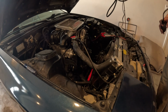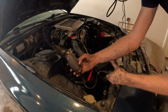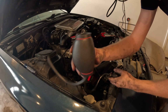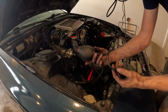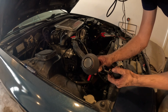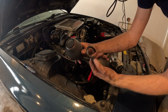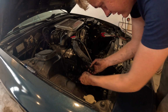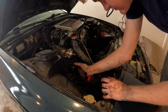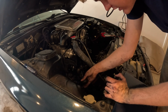So like you probably saw, they did not tighten that intake down, which can't be helping me. But anyway, I'm gonna start using this attachment here. Now, I ordered this, but you can get certain kits from Autoline that come with it. See how when I pump that up with this whole hand thing, it fills stuff? Pretty cool. So this will fill like an exhaust tip, in my case, an intake charge pipe, really anything cylindrical, which is pretty cool. You just let the air out with that. So I'm gonna set this in my intake, then I'm going to pump it up inside my intake,